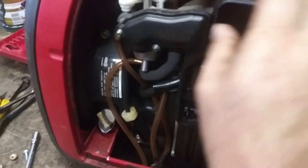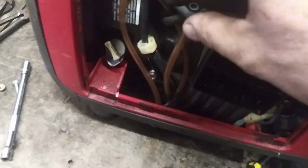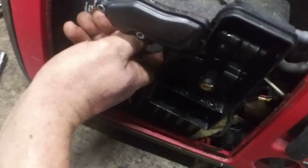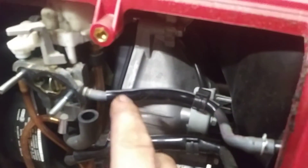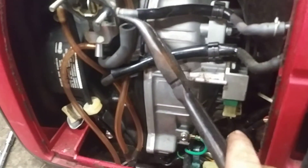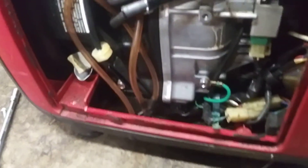Pull all this off after you get all the screws out. There's a hose hooked up right here — it pulls straight off the bottom. Remove the fuel line; there's a clamp you may have to turn to get to it, then use your needle nose to grab it and get it off. Then pop this hose out of this clamp here so it's hanging down.